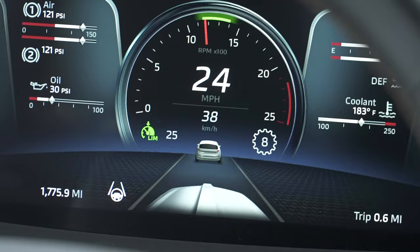Headway adjustment is the following distance that you want to maintain when using the adaptive cruise control system, indicated by the white bars between the truck hood and the car icon. These bars will turn blue when selected to adjust headway. Please note, not all trucks will be spec'd with an adjustable headway. The last control is the variable road speed limiter. To activate this, enable the cruise with the on-off button — you will see the cruise icon go white in the display. Then press the limit button to set your maximum speed allowed when using the throttle pedal. You can see your set maximum speed in the display. This is beneficial if you are driving through a construction zone or driving in the yard and you want to focus on your surroundings without worrying about exceeding the speed limit. When you are limited, you will see it in the display. Please note, not all trucks will be equipped with the variable road speed limiter. You can only have cruise control or the road speed limiter active at once.